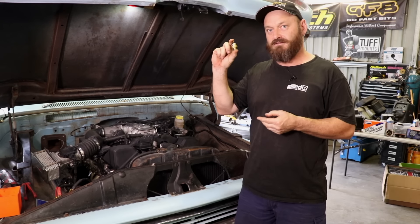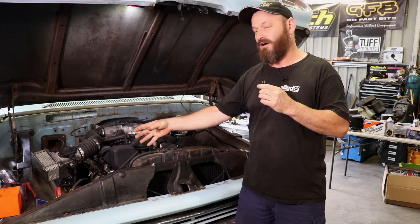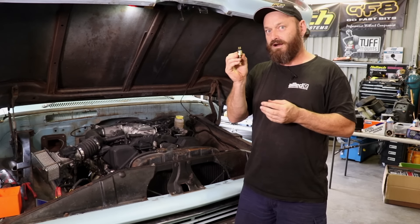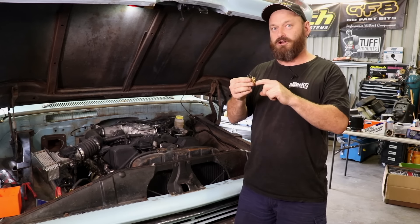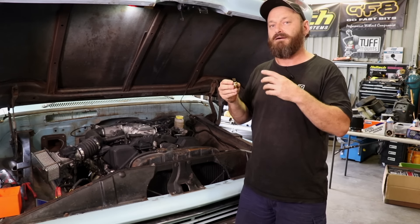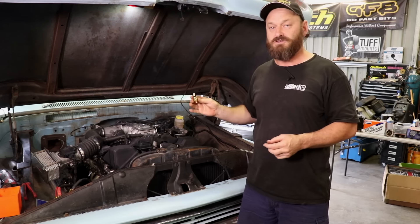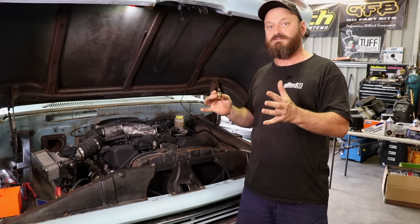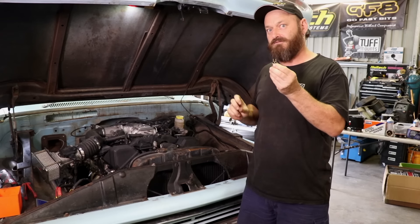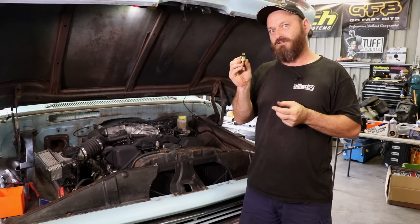So it's just normally open — when it gets to 95 degrees, it closes. That circuit closes, you wire it up to a relay, and your fan comes on. If you only have one terminal, it's basically something that goes to ground, so the only way you can control the relay that turns the fan on is via a grounding circuit. In the case of a late model car with air conditioning, if you remove the engine fan, you need the thermatic fan to turn on when the air conditioning turns on. This allows you to do it because you can use a diode and feed in power from the aircon clutch. That's why we use these rather than off-the-shelf stuff.